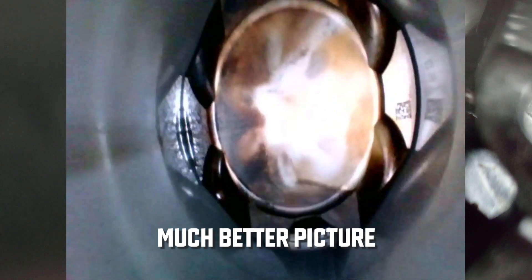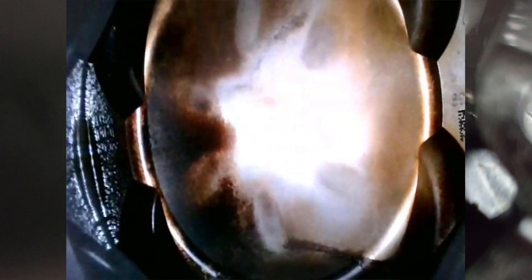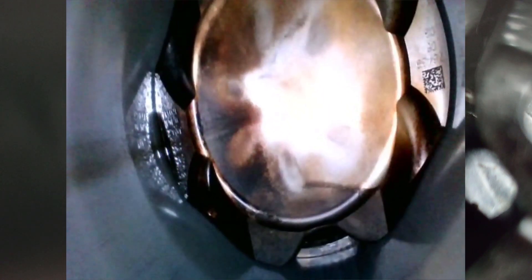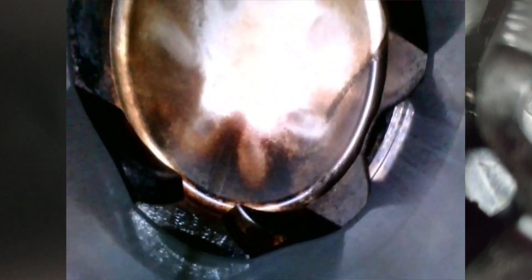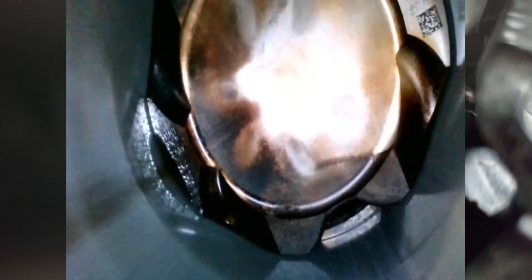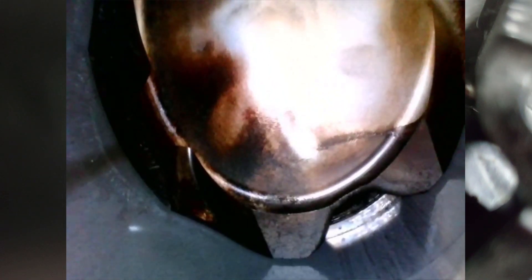I almost don't want to do this, but I'm sure it'll be fine. So that's cool — I guess that's the top of the piston. It looks okay, no obvious damage. You can even see the QR code on the piston. I can't see anything that would indicate... oh, is that it? There's a hole, isn't there? That is a hole in the piston. Damn it.